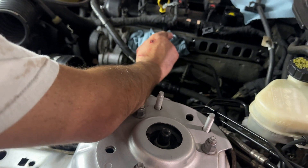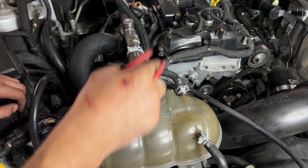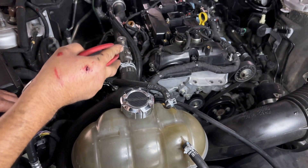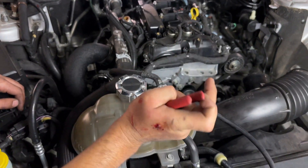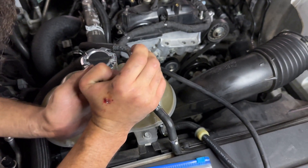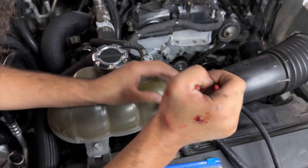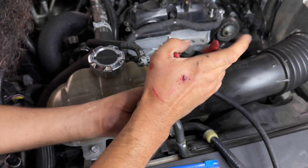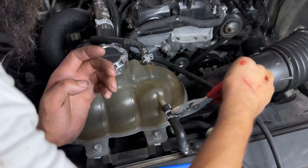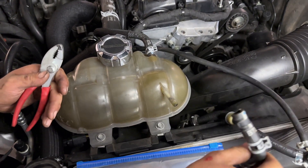You don't need to do this next part, but I'm going to do it because you want as much room as you can get — and these cylinder heads are not light. What we're going to do is take off the hose clamps. These are locking hose clamps, but if you have the right tool — I just take them, pinch them, and twist them off. Your hose will come off, and you're going to do the same exact thing to the other side.